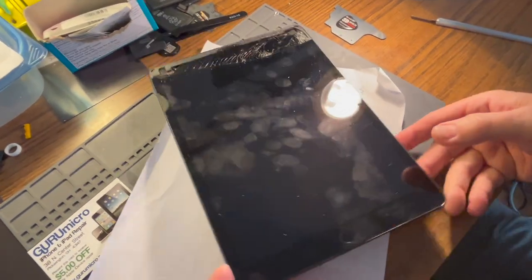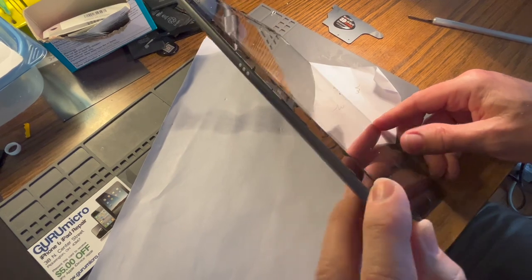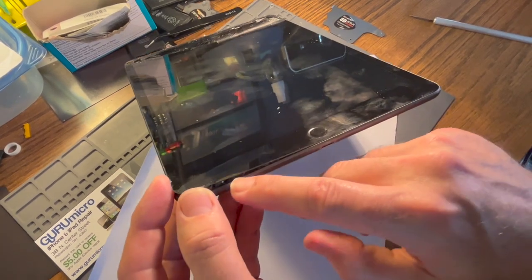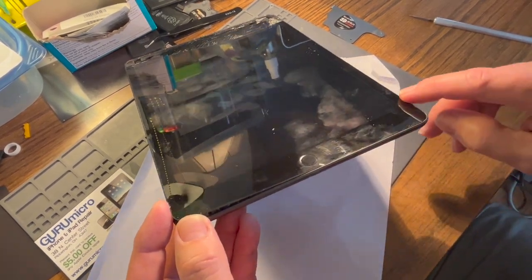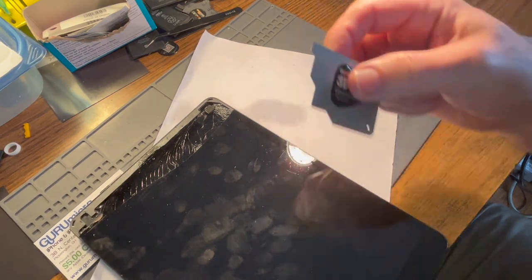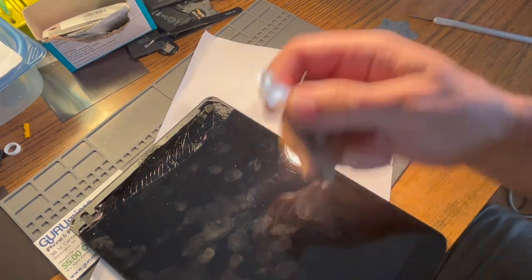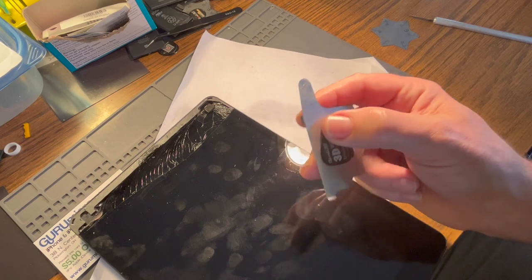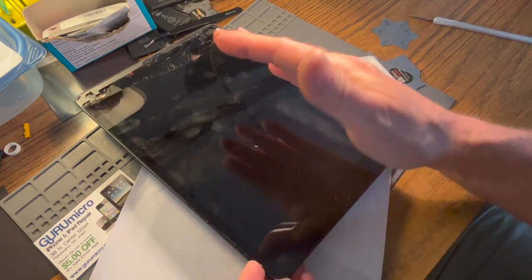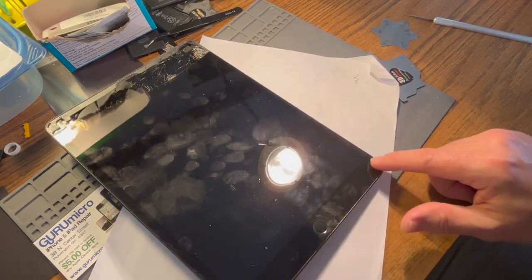I think I have this cut enough. You can see I'm able to lift this glass now, at least up to about the home button — we have a pretty decent gap. This is still adhered and I did not touch this corner at all. I did run my tool down this edge, just because I know that adhesive strip is so thin right here. I can cut it enough with alcohol, heat, and this tool to loosen it. I'm going to open this thing like a book. The sixth, seventh, eighth, ninth gens all open in the same way. This cable runs right here, and there are two more cables right here that go to the touch screen.